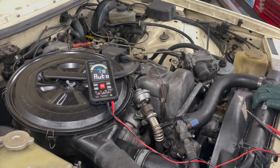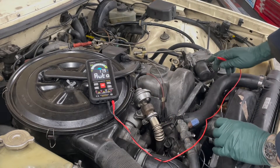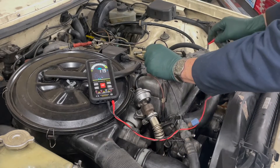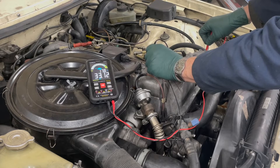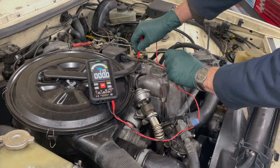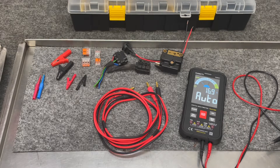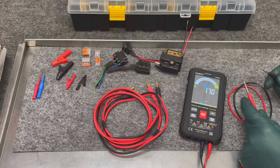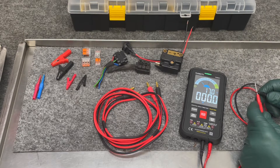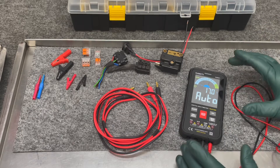Now to check continuity — let's say I'm testing a wire or a switch to see if there's continuity. I don't have to touch anything. I just take the leads and check continuity between this cruise control actuator and the engine. I don't have a ground to that cruise amp — that's the way it should be. Now going valve cover to valve cover you'll get zero and you'll hear a tone indicating direct continuity. You get the green light and the sound, so you can be in a place where you can't even see the meter — like under the dash testing continuity. This has become quite a time saver.